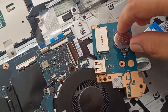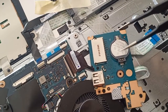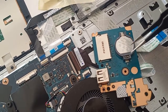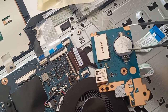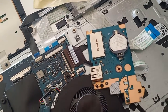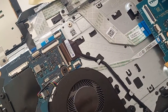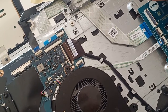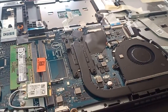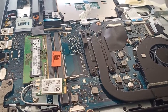Remove the CMOS battery. After you remove it, make a jumper connecting the positive and negative terminals. Remove the CMOS battery first, then return it back. You may now proceed to turning on. That's it — this is how to troubleshoot your Dell Inspiron 15, specific model 3501. Thank you for watching.